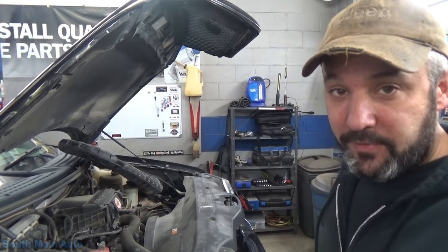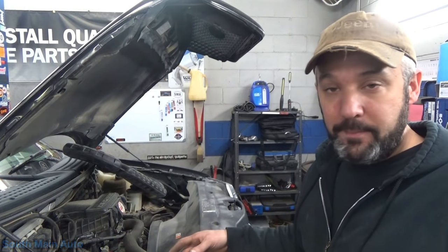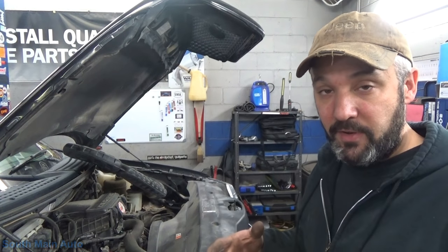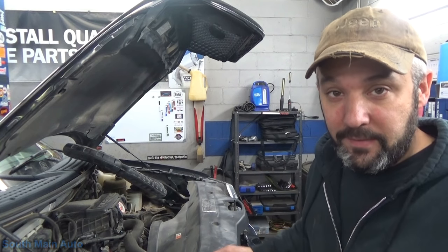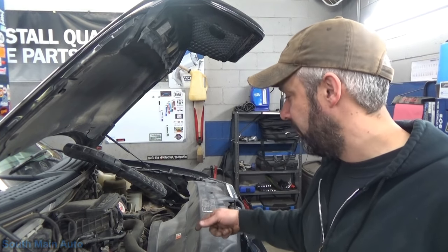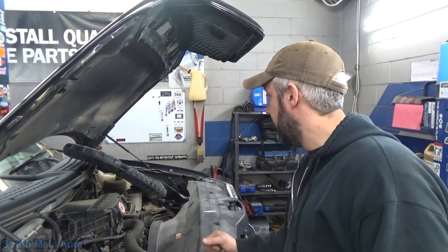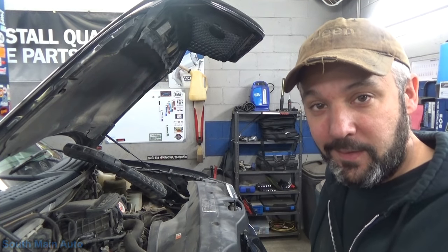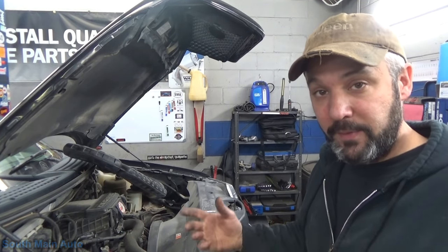The only reason I'd say it's good to get some direction prior to pulling the belt is because, like a wheel bearing or any other bearing, sometimes it can make noise under load — the tension of the belt on there. But then you take the belt tension off, spin it, and you can be really indecisive; it doesn't really sound bad. This one's pretty bad and may be growly once we pull the belt. I'm going to see if somebody has a belt tensioner for this before I take the effort to tear it apart, and if they do we'll get one coming.